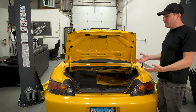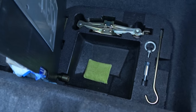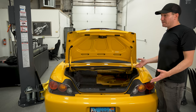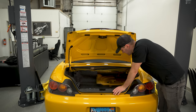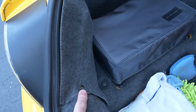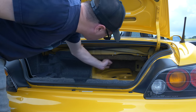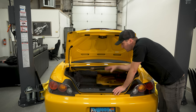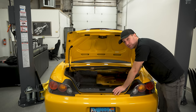When you get in the trunk, look at the condition. If you see it's missing the jack, tools, or tow hook, or they're severely damaged, that means someone went through some type of ordeal. The whole trunk is lined with a felt material — if it's damaged, missing, partly removed, or there are a ton of clips out and the spare tire is mangled, chances are this was modified. I've had to remove part of mine to reach the shock towers to adjust my dampers, which is really common on these cars. If you see a perfect trunk lining with all the clips and everything looks pristine, this car's probably never been screwed with.